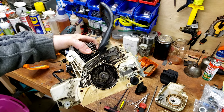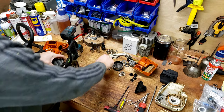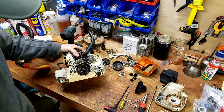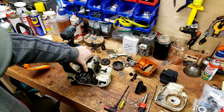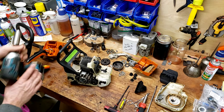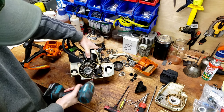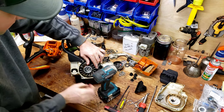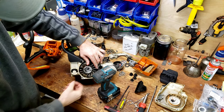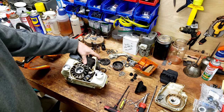That's usually what they look like behind there. The worm drive gear for the oil pump will come out — they almost always look that nasty, so there is cleaning to do when you get in here. That side's all disassembled. Now we can take the flywheel side off. Same thing with the flywheel, but it's a right-hand thread, so counterclockwise like normal. 13mm — that'll come off.